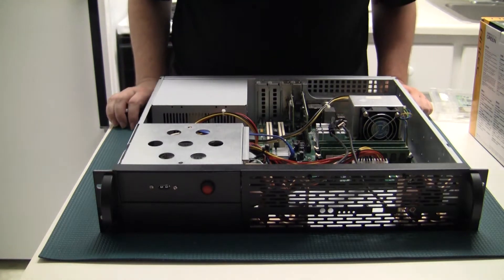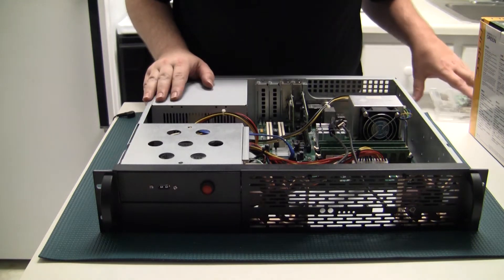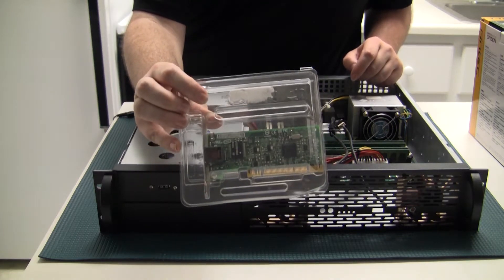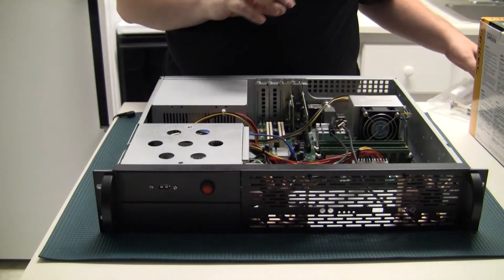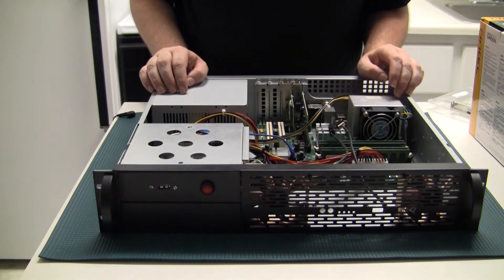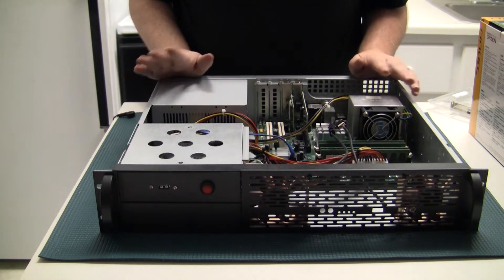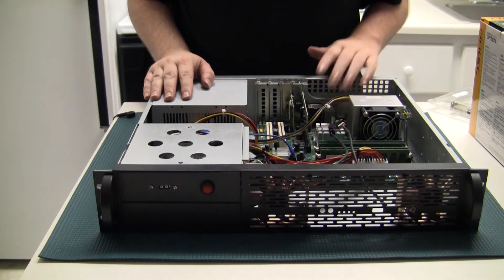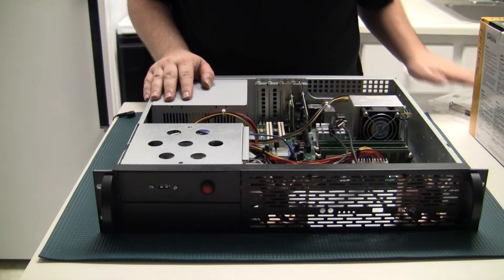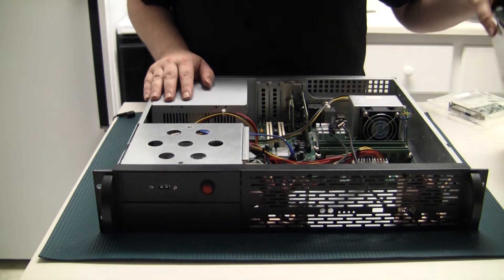Hey everyone, this is a little update on my pfSense router hardware. I'm going to put in a new gigabit ethernet card and replace the onboard one, because Comcast updated my service to 105 megabits per second. I've done some speed tests and I'm only getting about 94-95 Mbps, and that's because of the limitation of the onboard LAN controller. I'm going to do some new speed tests and see if I can get 105.